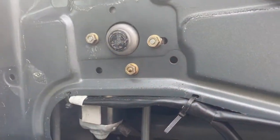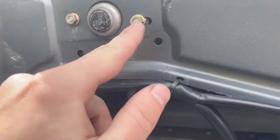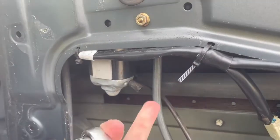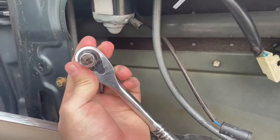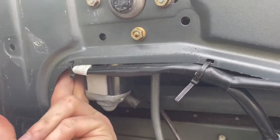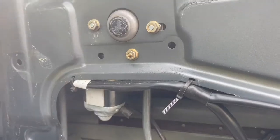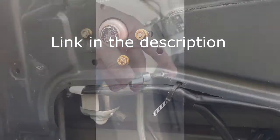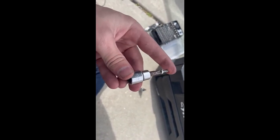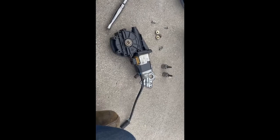To get this motor out, it's these three 10-millimeter screws, and then there are four Phillips heads on the inside, so you're going to need a tool like this to reach them — they sit on the inside and it's going to be kind of a hassle. I'll link another video on how to rebuild these things; use a number two Phillips for those back ones.